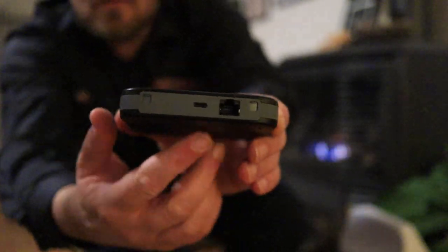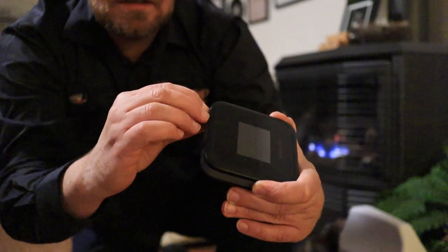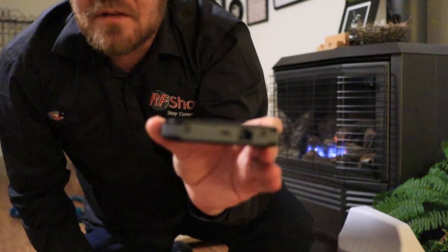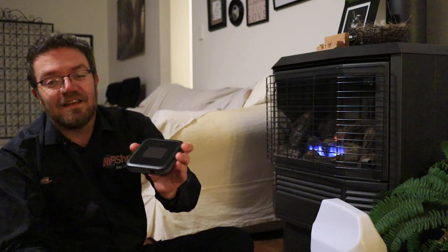You lift the sliding door and you'll see two exposed TS9 connectors. That's essentially all there is to it — you take the TS9 connector tails and plug them in. A simple test you can do is connect the cable without an antenna to the TS9 on the modem itself and you'll see a drop in signal. It sometimes works, sometimes doesn't, but it shows the concept.